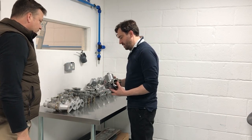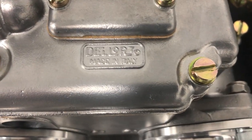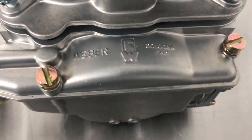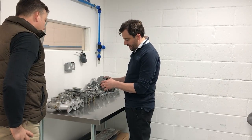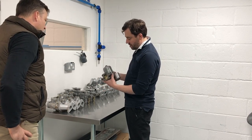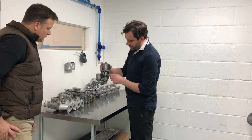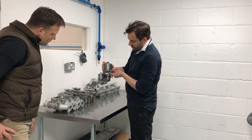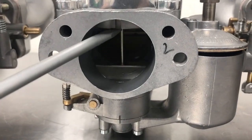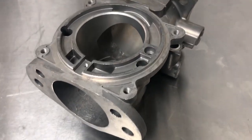There are a couple of different ways that carburetors work. These are side-draft carburetors and downdraught carburetors - Delottos and Webers are Italian carburetors, which are a sort of sporting carburetor. These are English carburetors - SU, Skinner's Union. This is a constant depression type carburetor, which essentially works by: as you open the butterfly here, it creates a vacuum which allows the piston to rise up and reveal the venturi in there, which accelerates the air across the top of the orifice, which is known as the jet.